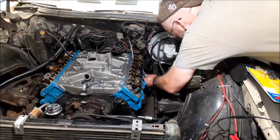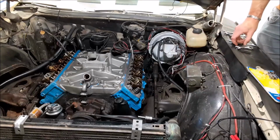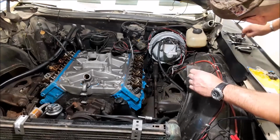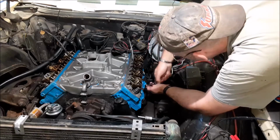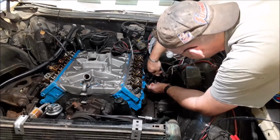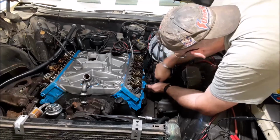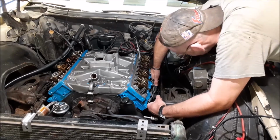Here we go. Just gotta hold your tongue right now. Again, it's just this one right here that's got a little bit of grit in it. And got one of these header bolts that I'll run in there with some oil on it. These were hot tanked at the machinist, and then I had tape over the gasket surface when I spray painted them. So it's just some sort of grit, some sort of nastiness. Get it snug and back it back off. Now, so much for the nice paint on the headers.